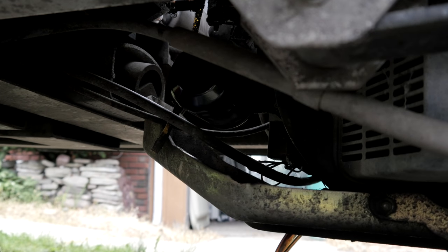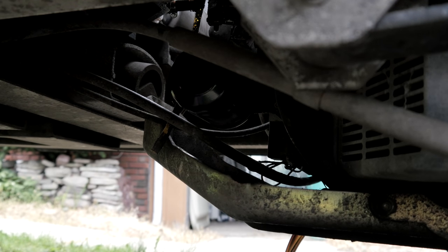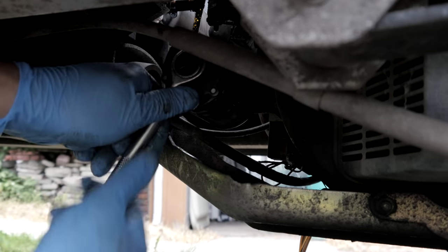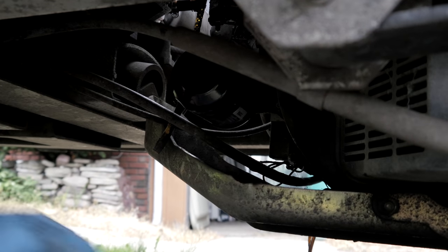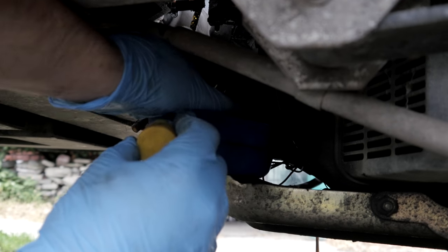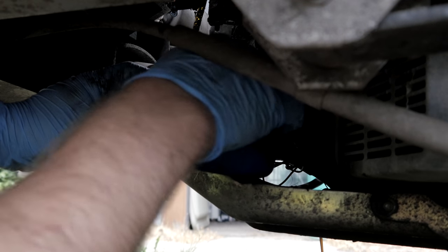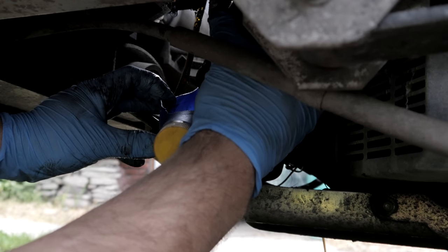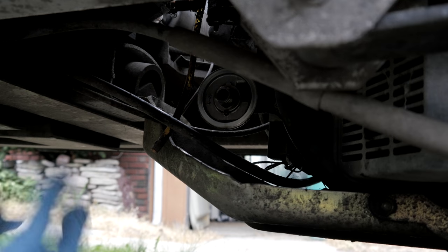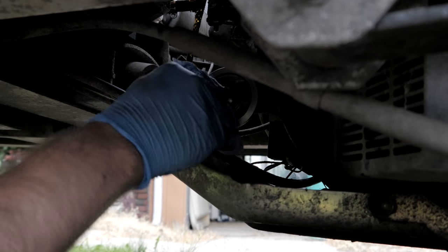Looks like I'm going fishing for that drain plug. So we've got the oil draining. I've got my fancy oil filter wrench here - works in reverse, it bites down. Then I take my little oil container that I cut in half - that's how I catch the dripping oil so I don't make a mess. Okay, so we've got the filter out of the way. I'm going to wipe off the face of this oil filter spin-on zone here, just to make sure it's clean.